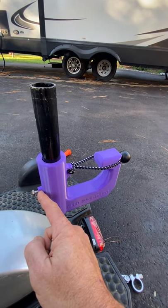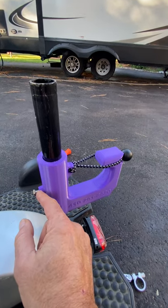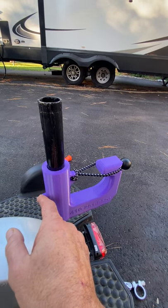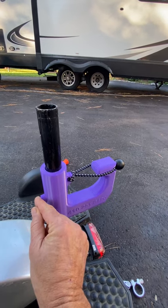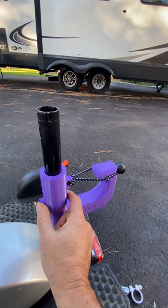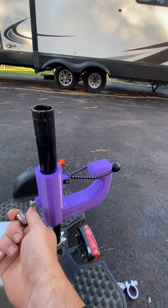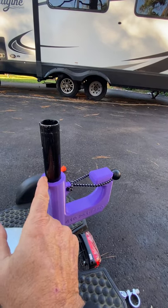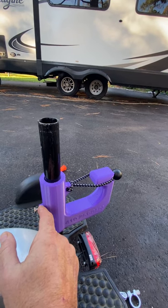Now, if that happens, what you want to do is go ahead and tighten it and show your crack — you can take that as you choose. Put some crazy glue in the crack and then loosen it, and it will want to pull itself back in if you didn't completely break it off. This is just meant to be tensioned, not torqued on, because when this screw hits the pole it has nowhere to go other than to pull the nut out, and the plastic being less noble will give.